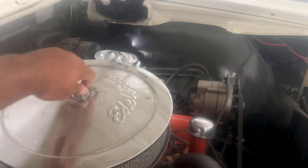Once you have the car started and running, you definitely want to warm up the car before driving, because it is a carbureted engine. You want that oil circulating and gas getting into the carburetor. Let it sit, rev it a couple of times — usually just 30 seconds, let off, do it again. This gets the RPMs going and gets the engine lubricated before heading out. Hit like and subscribe if you like my content to watch more videos.